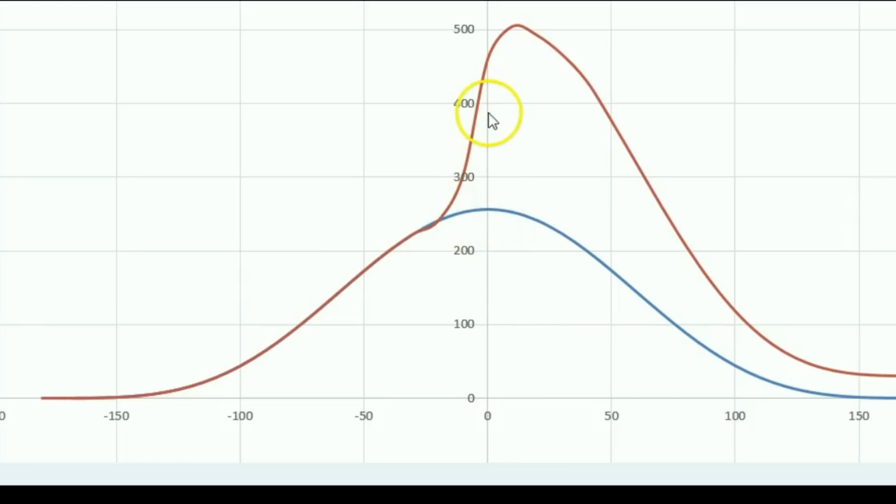So if you simply fire the spark plug 20 degrees later, what happens is that now the piston has already compressed the air all the way, and the piston is uncompressing the air as the air-fuel mixture is igniting. So the combustion, therefore, is not just slightly slower; it's quite a lot slower, and therefore you don't get such high pressures over here. You get much lower pressures, and the graph actually looks something like this. Like it's a much lower pressure, therefore it takes a lot longer for the air-fuel mixture to ignite, and then there's a lot of wastage over here.